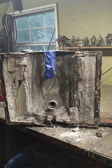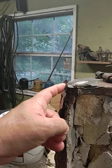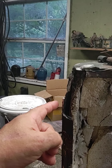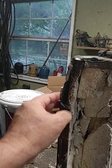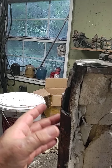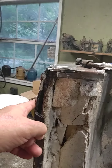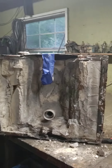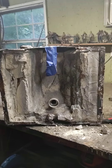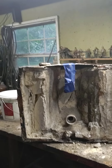Now's the time to do all of it. I am going to do this differently when I put it back on. It was welded on the four corners, and you can see where I had to cut it pretty drastically with the Metabo. I think what I'm going to do is sit it up on there, square everything back up, probably heat this up with a torch while everything's busted up now, square it all up, and then weld some brackets to put bolts through and just bolt it down on the four corners. With the amount of glass cloth I'm going to put in, you won't get any leaks out the edges anyway.